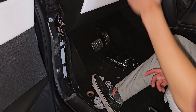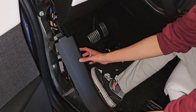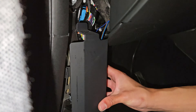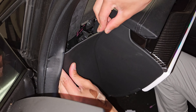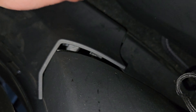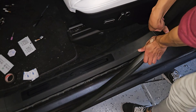If you put the weather stripping back on for testing, take it back off again — now it's time to put the car back together. After wiring everything and putting the carpet back, we're going to get the kick plate that goes on the bottom side. This one doesn't have any special clips — it just goes in straight. It goes under the leather part, which makes it easier to push in. Press it in, all clips are in, and put the screw in. Put the top part back on at an angle so you don't break the clip, lock it from top to bottom, and clip it into the other clips.